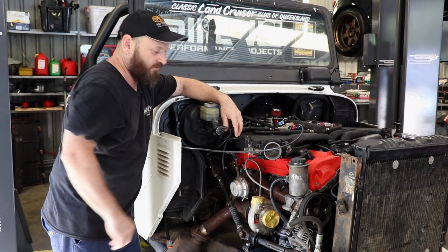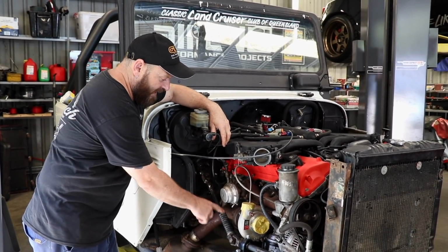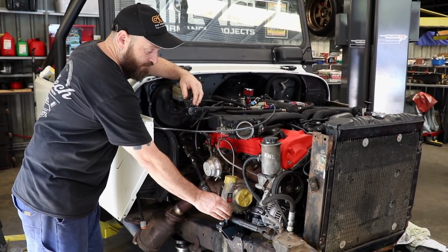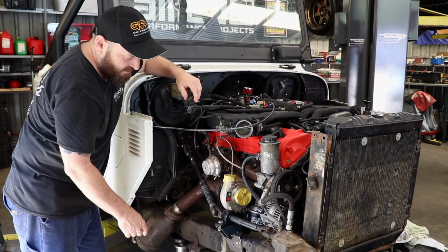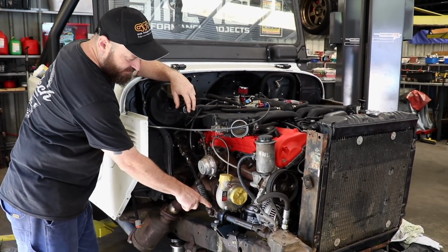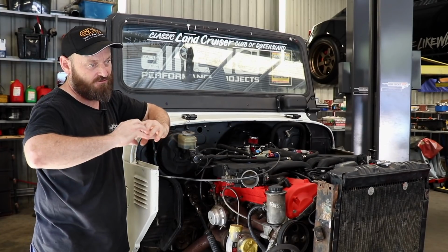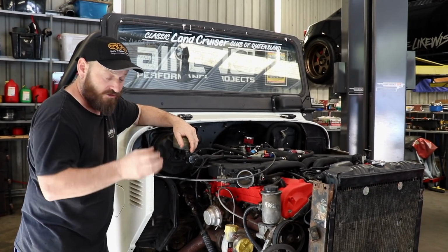So also can't weld steering parts, that's probably a fairly standard thing. All I've done is use bits to sort of see where it will work and get the point where this plummer block can be. So I've done that with various bits and pieces and welded it there. When I've tested it, that is too tight. You can feel every quarter the uni is past its usable range and it starts rolling over and you get this feeling of a bind every quarter of a turn.